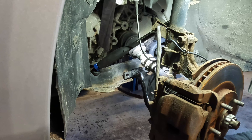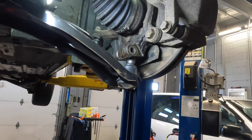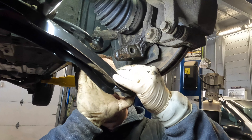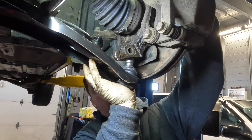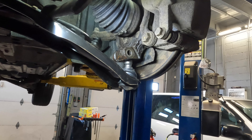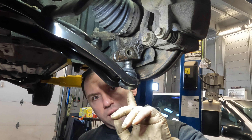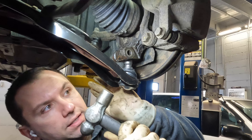The way I do this is we're going to install our lower ball joint first. I'm going to raise the vehicle and then dislocate our strut tower from our knuckle assembly. I just want to make sure the ball joint goes into the knuckle because it will help support it — all you should be doing is getting it lined up. Sometimes there's a little bit of rust that causes it not to want to go in, and then you can use a hammer to tap it into place. Do not hit on the bottom of this ball joint because that is where the grease cup is — just tap on the sides.